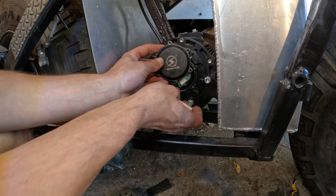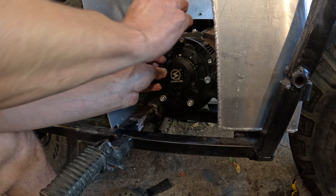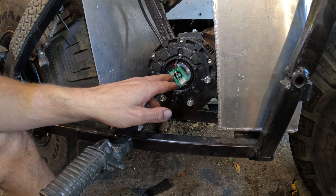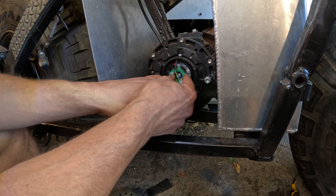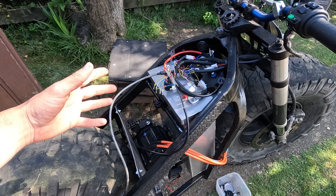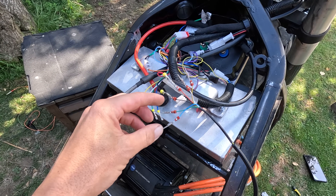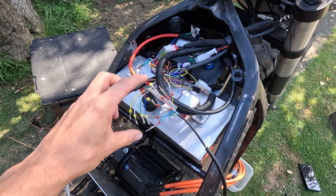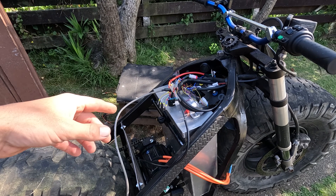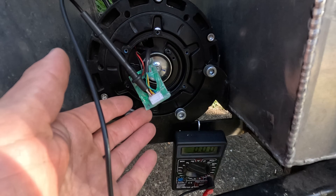So I took this little cover off, which is actually quite hard to do — I hammered a razor blade in each side to pry it off. Now that I'm in there, everything's all siliconed up, but at least I'll be able to probe those wires and test that there's not a fault somewhere. Matt from America has been helping me through Messenger. I've been rolling the bike back and forth and testing between the wires to see if the hall effects are picking up the magnet and sending a signal, but they don't seem to be working consistently, or at all.